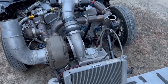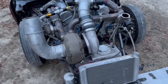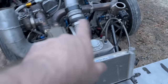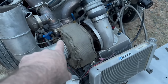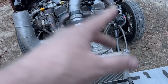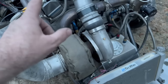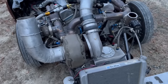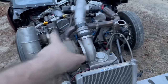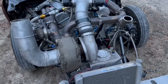This is the traditional wastegate setup on a gasoline engine. Big diesel engines like semi-trucks — a lot of modern diesels have wastegates, but they're internal, built into the turbine housing. Older big-rig diesels don't have wastegates at all; they size the turbo so that at a given RPM it's running at full capacity. In a race car application that's generally not the case — you use external wastegates and this is how you control them.